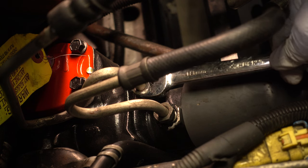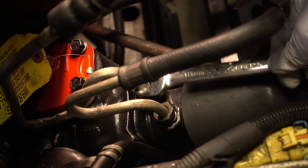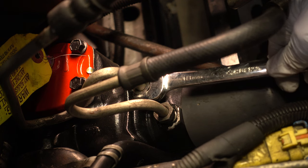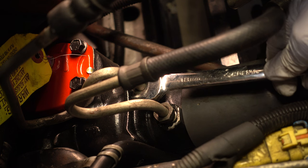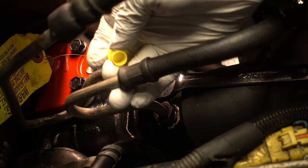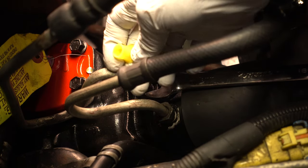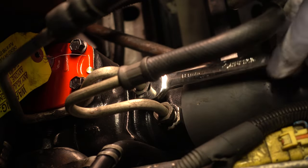I'm thinking of coming down to the steering gear, removing the pressure line from there, and capping it off. Then I can replace it with the new line and get that done and ready for the pump side. This kit also included a little cap, and I believe it's for doing just that — removing this line and capping it off.